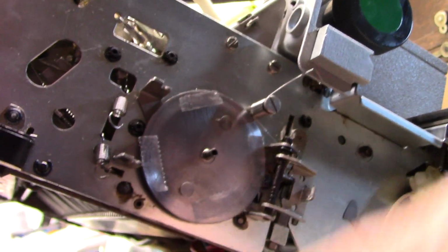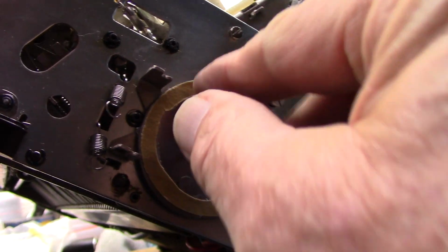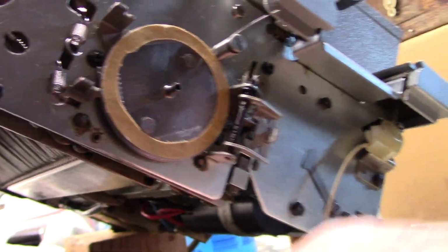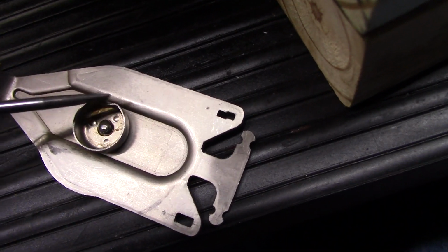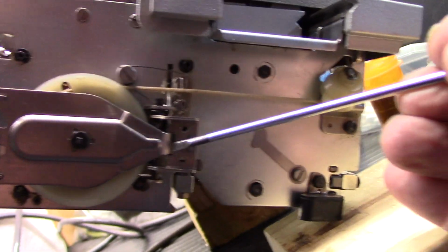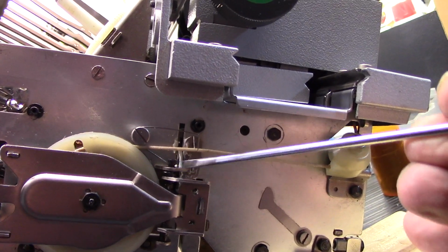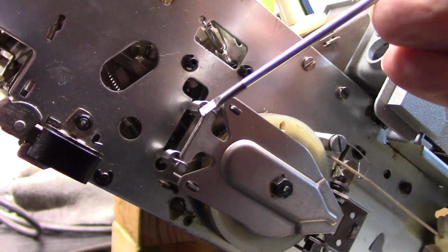Okay, I have some double-sided tape on the perimeter, and now I'm going to try to stick it on and get it concentric. Hopefully it'll stay on. Looks like it'll stick. Now the fun part is putting this back on. There's a coil spring in here, and the center of it, this little hook, I have to snag into this little part right here when I put this plate onto the disc. I set it on with this bracket. The short end of it goes underneath this slot here. There's a little spring that holds the drawband up out of the way, and then the other side of this bracket fits over these two slots, and you have two strong springs that you have to connect, pulling this plate back. So that's the clutch mechanism.